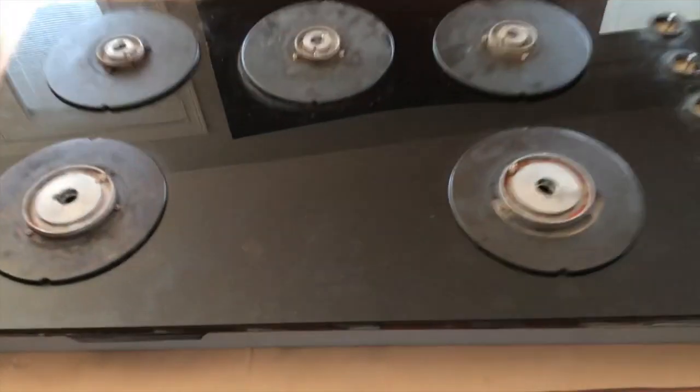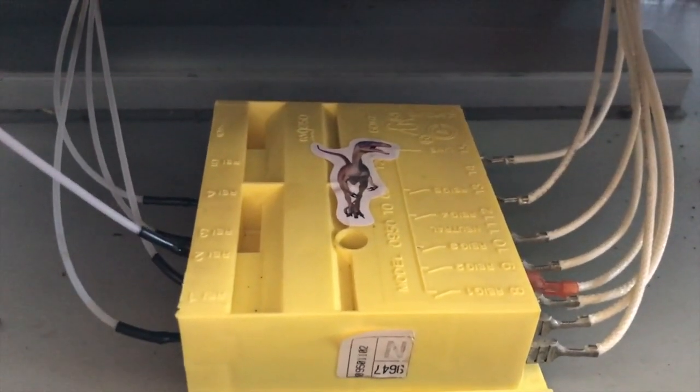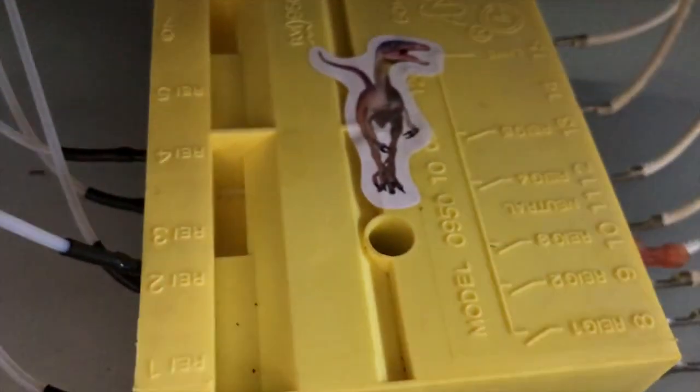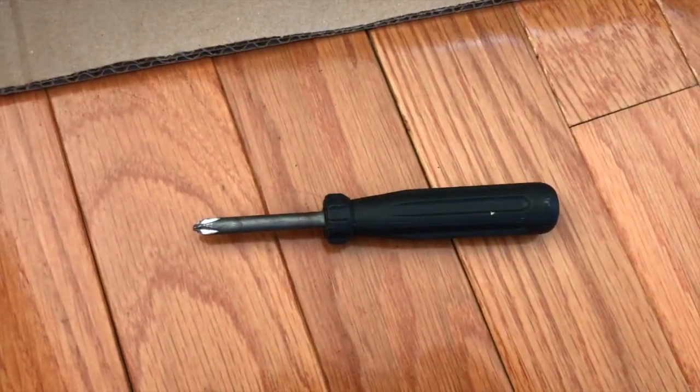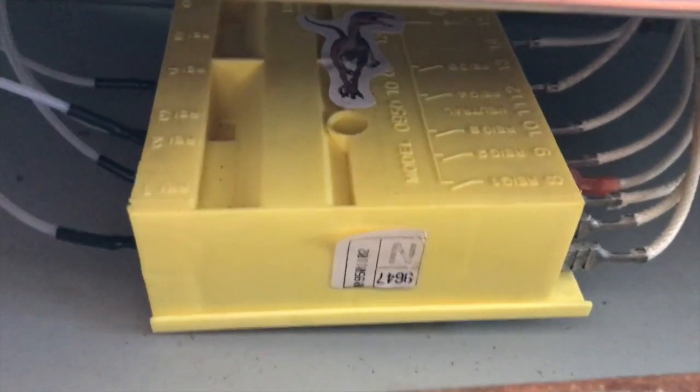The cooktop is back in the upright position. Go ahead and raise the actual cover of the cooktop — there is your module. We replaced that in a separate video. Inside that little hole is a Phillips screw, and on the back side there is another one. You do not need to remove the back screw — just loosen it up and we'll be able to shift this control module to the left and out of its groove. However, that center screw we will remove fully, and you will need a small Phillips screwdriver to get in that tight spot. Be careful not to harm these electrical cords. The screw inside the hole is fully removed, the back screw is loosened, and we've shifted the control module to the left off that slot.